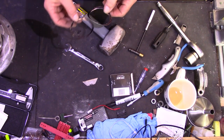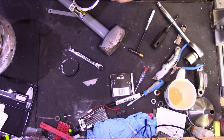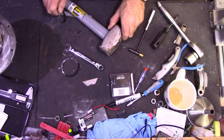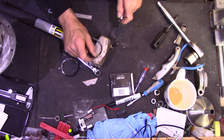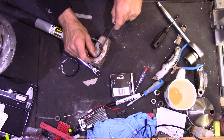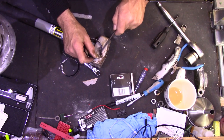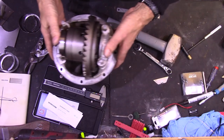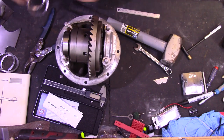That's the two shims cut. What I want to do is just reduce the burrs around the edges — using the side of a lump hammer as a hard surface and a brass-faced hammer, just go around it gently to try and flatten out those burrs. Now we can turn our attention to getting these two shims in in a nice orderly fashion.